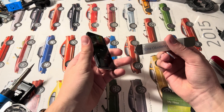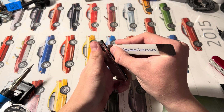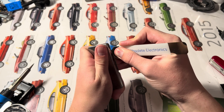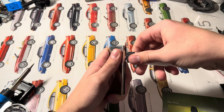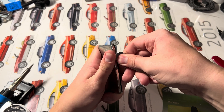First, how to open it. If you've opened any iPod Classic, it's pretty similar. You just simply slide an iPod opening tool into the little seam between the back and front plates, then push and find all the clips.